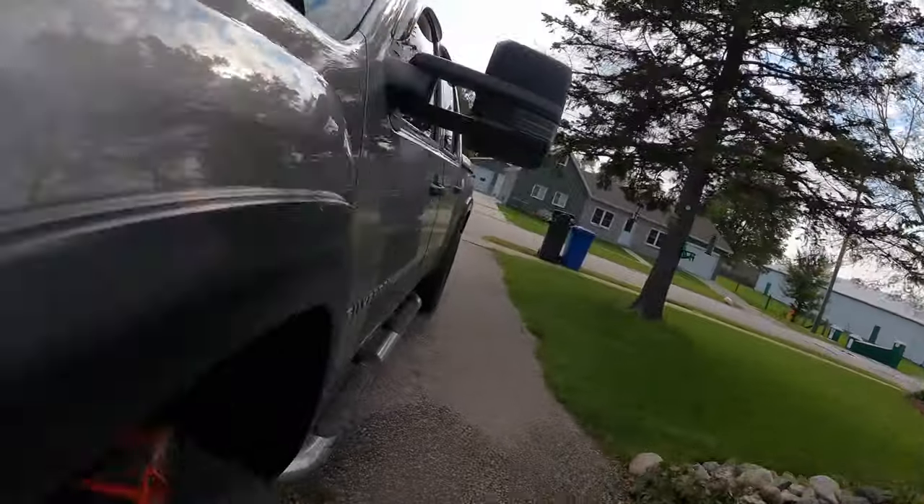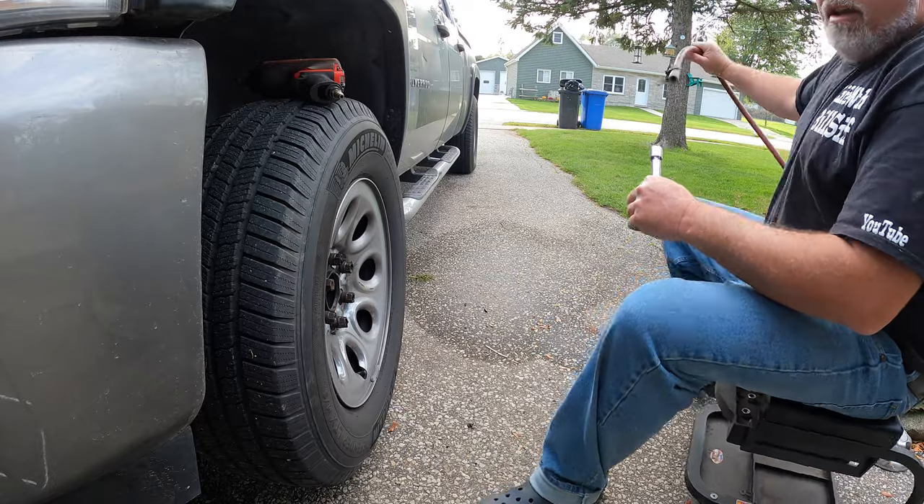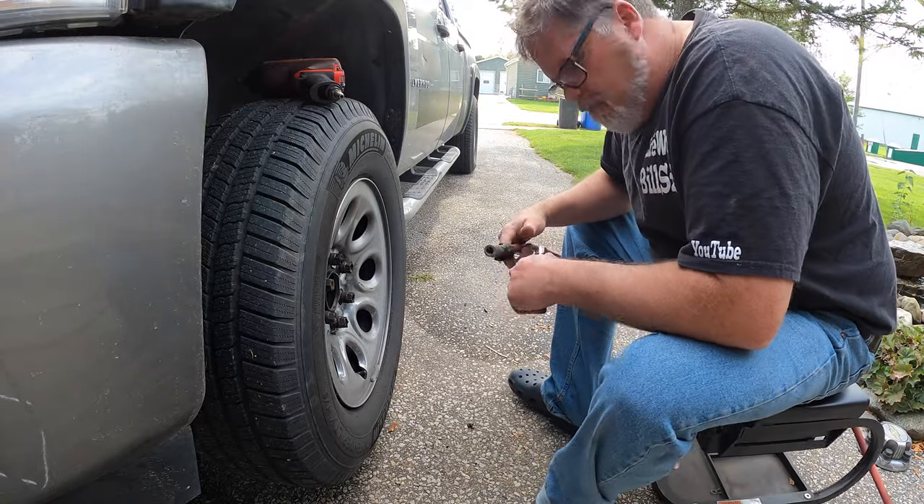When you're starting this job, the first thing you do is take your brake fluid cap off, or you'll just spray brake fluid all over your face. I'm kind of hoping to get this done before it starts raining again.